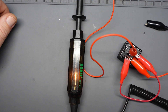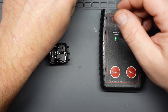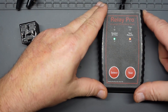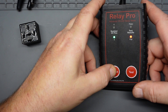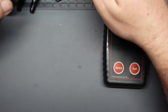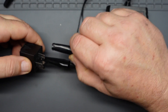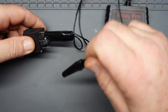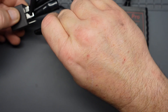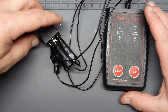So that's the basic deal — and by the way, you shouldn't wear jewelry when working with electricity. Do as I say, not as I do. We've got power going to the relay tester. There's a select switch for four or five pins — the green light indicates the setting. You just come in and hook up all the wires. I like that these wire boots have a little slot cut in them; makes it easier to get them onto the relay pins. One, two, three, four, five — then you push the button.